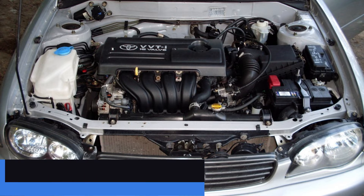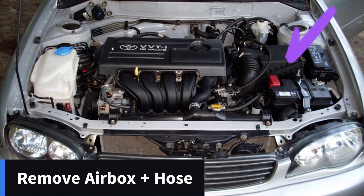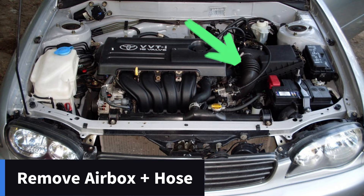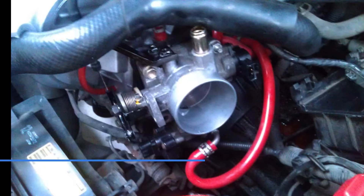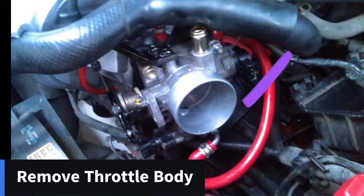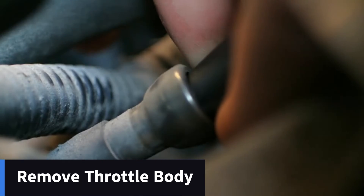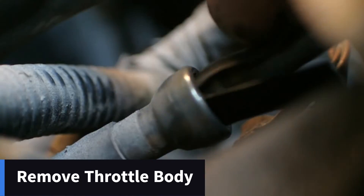The starting point: take out the airbox on your car — if you don't have one, that's fine. Next, remove the airbox hose to your throttle body, and then remove the throttle body from the car. There are going to be some hoses connected to the throttle body that run to the engine block. Just label these so that you remember what they are when you're reassembling the car later — don't have a bunch of hoses hanging around with no idea where they go, as that'll set you up for disaster.